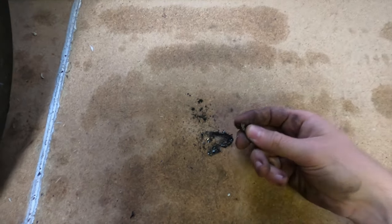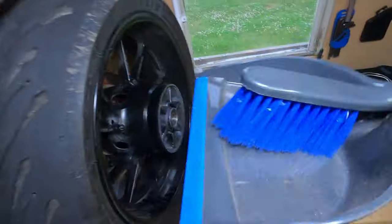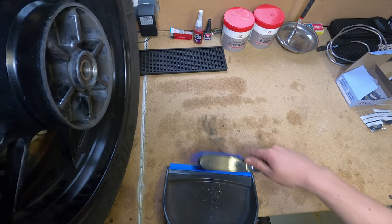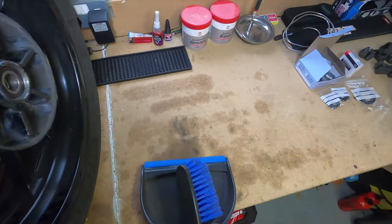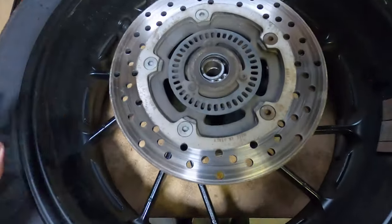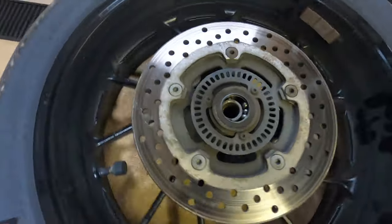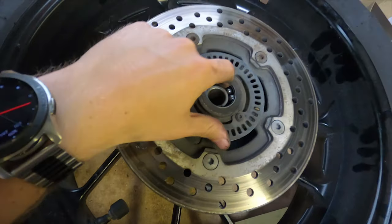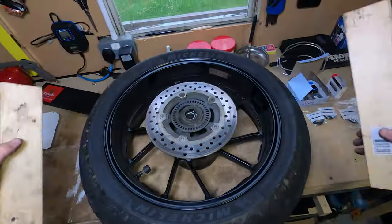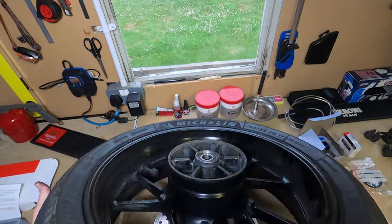That shows you that the bearing's buggered. There's all parts of whatever that is there. Without putting the wheel back down, let's see if I can clear that up, because I do not want that going anywhere. I mean, I'm going to replace the tyre anyway, but I don't want that going anywhere near. So if I turn this over, you can see that is the bearing there. You can see all the balls from the bearing in there, and look, yeah, it's just absolutely toasted. Generic blocks of wood. Let's do the non-buggered side first, shall we?